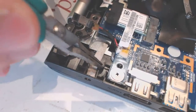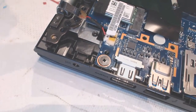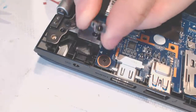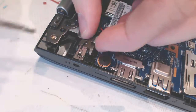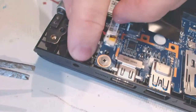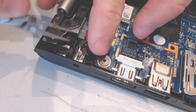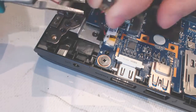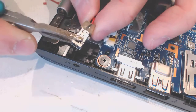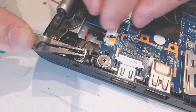We need to remove this guy and that guy. We need to remove everything that's loose. The jack is fine — you can see the jack is fine because it's just a classic case of the jack being pushed in from the side. The problem is that if you put glue anywhere here, it's going to penetrate into the jack, and once it penetrates the jack you won't be able to push any plug into it anymore.